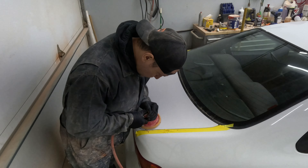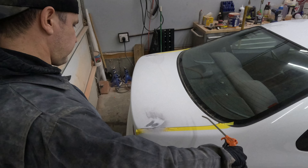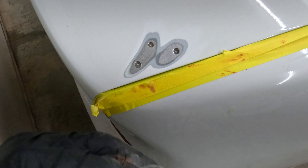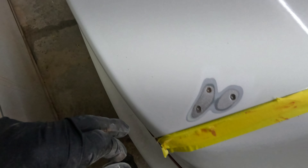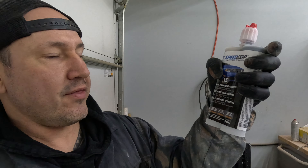Oh my God! I had some tape or paint on my hand anyway. You can see I drilled them out to where that fiberglass starts. I did try and scrape it off with a screwdriver — it is pretty solid. So I'm just going to reuse this. The only right way to do this is to weld up the holes; anything else is half-assed. We're going to use some body panel adhesive — it's good for about 600 PSI.